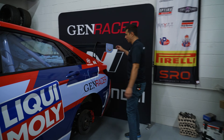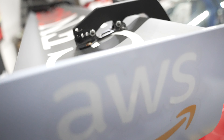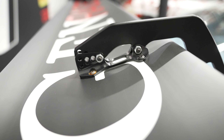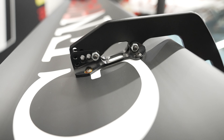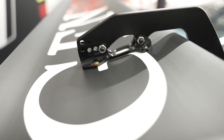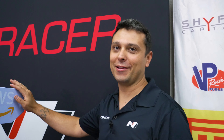We are using, straight from Hyundai Motorsport, a TCR wing. All we're doing is buying the part from Hyundai Motorsport, welding our tabs onto the trunk to be securely mounted, and we have a tuning function with multiple angles for any type of tuning we need. It's front wheel drive, and it does help — a lot of people say it doesn't because it's front wheel drive, but we couldn't go fast without it, trust me.